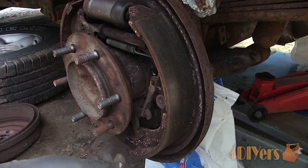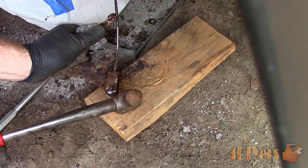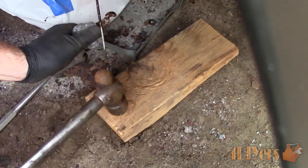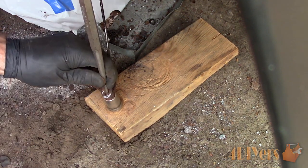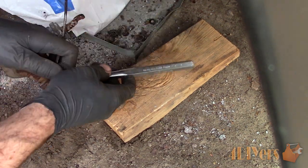Disconnect the mechanism on the inside and then pull off the bell crank. When the bell crank is in the air, it's tough to get a good solid hit on that pin. Make sure that cotter pin is removed. While it's on the ground, any rust on that pin should be cleaned off using a wire brush or file. The new bell cranks do come with new pins. Using a hammer and a socket underneath so the pin has somewhere to go, knock it out. A punch can also be used to help assist it out.